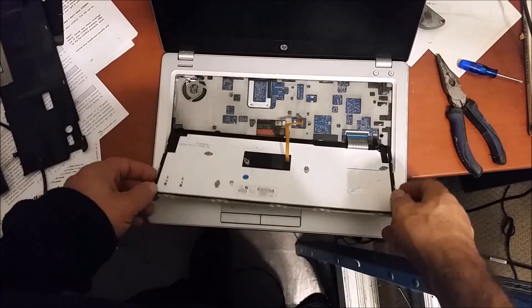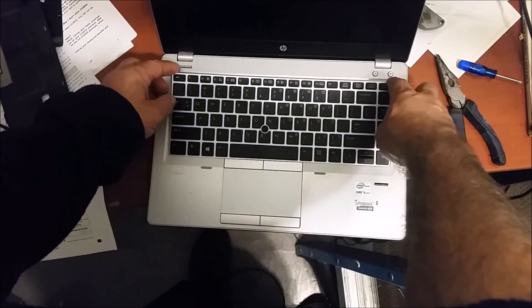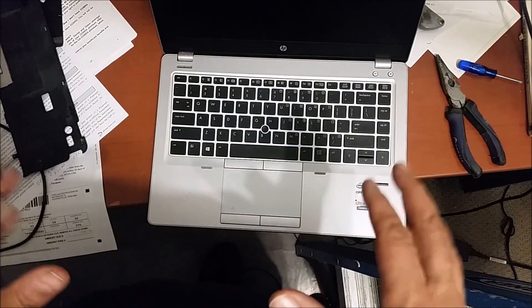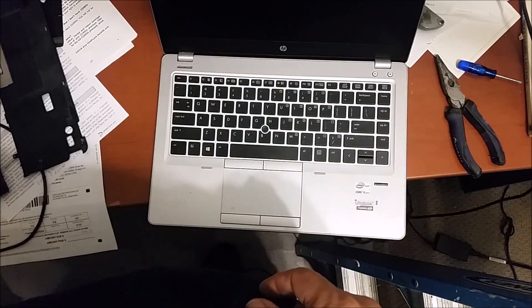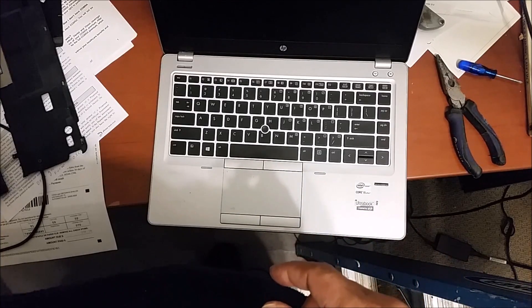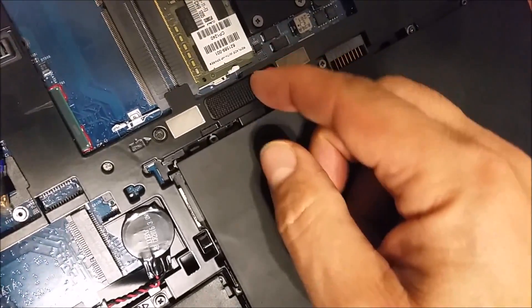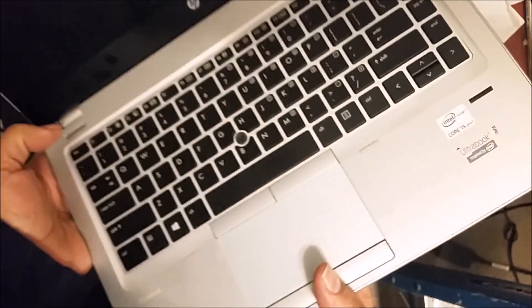So what I want to do now is just flip it gently. I am not going to close it or set everything in yet, because the first thing I want to do is check to see if the keyboard is working. If it does not work, probably the connection is not good, and it is better to check before you close everything. What I am going to do now is connect the battery and turn on the computer to see if everything is working. You can see I am putting the battery back. Now I can turn on the computer and we will see what happens.